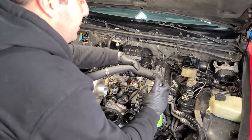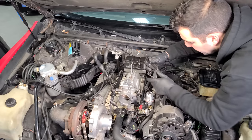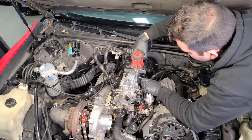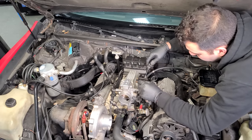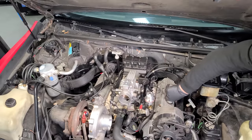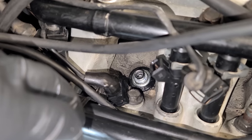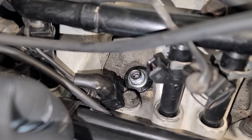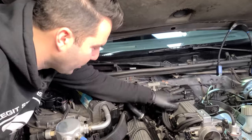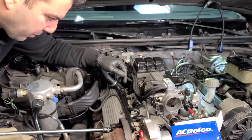Next up is our new upper radiator hose going over our new aluminum thermostat housing with the new thermostat. Let's get our throttle bracket back on and clip the cables through. It took me so long to find a grommet for the PCV — I have like four extra ones now, no one at the parts store could find one. But I finally figured it out. We now have positive crankcase ventilation restored. With the coil on, I connected everything and ran all the vacuum hoses nice and neat. I'll show you the final product when we're done.